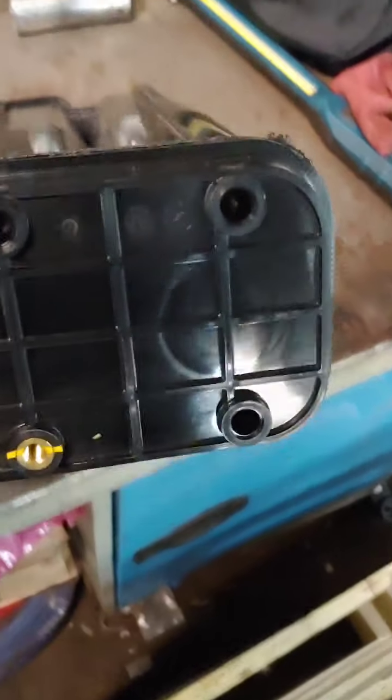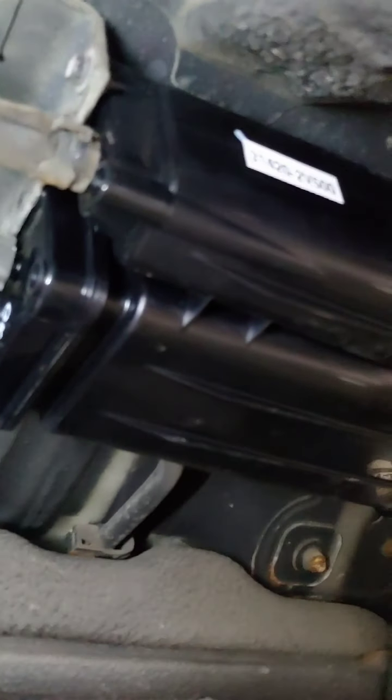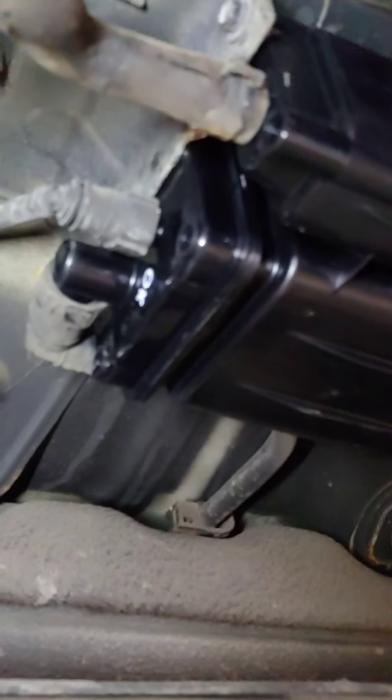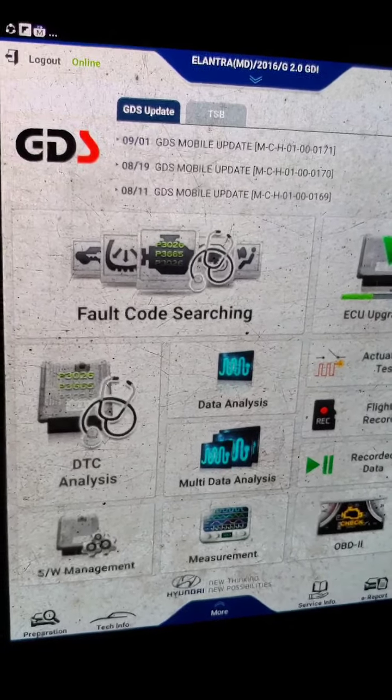Here's our new part — let's compare it. It's clean and has the same mounting locations and the same pipe connections. Let me go ahead and install this. As you can see with the new charcoal canister installed, we don't have any leak so far. Let's put everything back together and run the EVAP test to see if it passes, or we can do two driving cycles to ready the EVAP system.